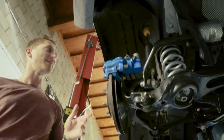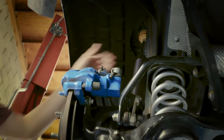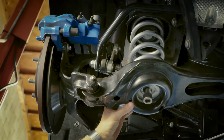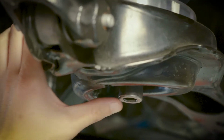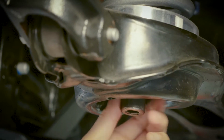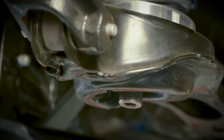And I know what you're thinking. If I don't have a coilover, how can I adjust the ride height? And I can adjust the ride height in the front, so I definitely want to be able to adjust the ride height in the rear. Seth Spec's got the solution. He designed an adjustable spring bucket that mounts right below the spring here, and with this Allen, you can adjust up and down the height of the spring, which adjusts the ride height of the vehicle.